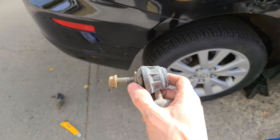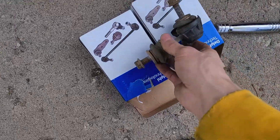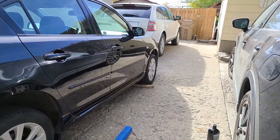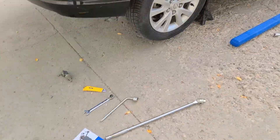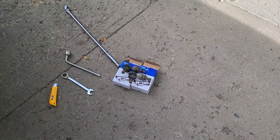It's so minute that I can't show you — it's literally a feel thing. It's a preventative maintenance thing; they're going to go at some point. The front ones usually always go first since there's more weight up there, but they're cheap and easy to replace. If you're under your car doing other work, you might as well check your sway bar end links — you have to take them out to feel that tiny little play.